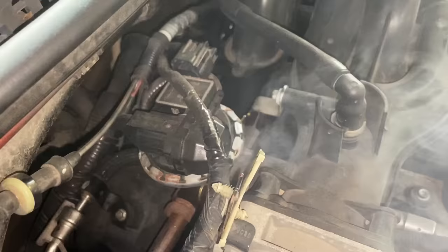After replacing the EGR valve gasket we were able to fix the problem. After letting it run for a little while the fuel trim numbers did start to come down — that was definitely a fix. I know this is probably a really short video but hopefully I was able to help someone out and you guys learned something from it. As far as the YA200 scan tool, if you're interested I'll leave a link in the description — you can pick it up for less than $25 and it's a tool pretty much anyone who owns a vehicle should have.